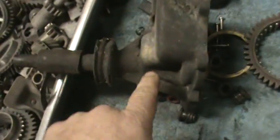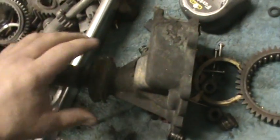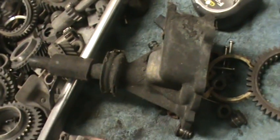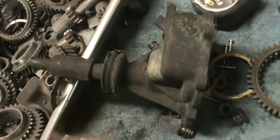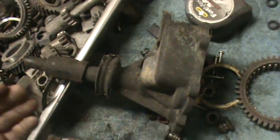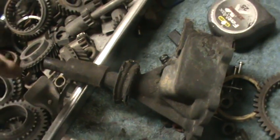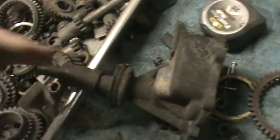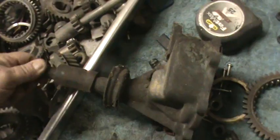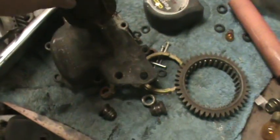The other thing that's different on a bus is the location where this rod runs through the shift nose cone. It's lower on a bus and higher on a sedan. If you put a sedan nose cone on a bus, the shift rod will be out of angle and won't be properly aligned. The shift rod should be straight and parallel with the hockey stick - you shouldn't have to push it up or pull it down.